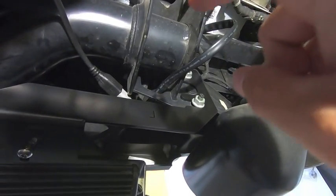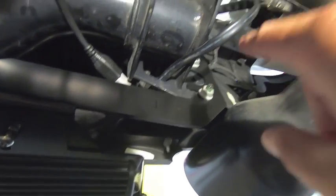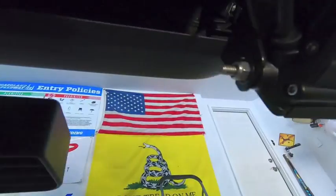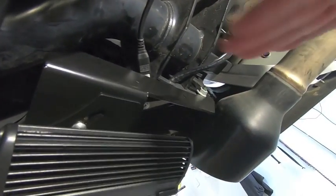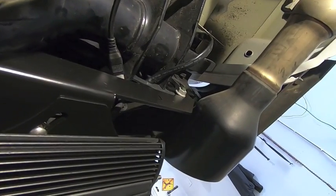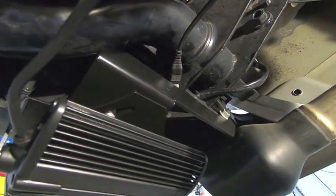One thing that's a common issue when you're running reverse lights and if you have rear parking sensors is you'll get interference between the two. So do your best to try to keep these wires away from any of those rear sensor wires, because the second you turn them on, there might be interference. And if you do need to cross them, cross the wires at 90 degrees, perpendicular. Don't run them side by side, because then you'll get flux out of the wires, and that's what causes the issues inside the sensor, and then your sensors will be going haywire when you're not even close to anything.